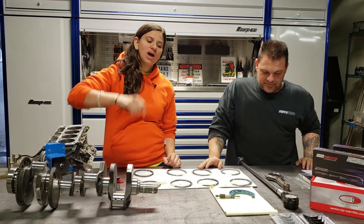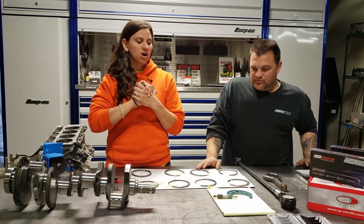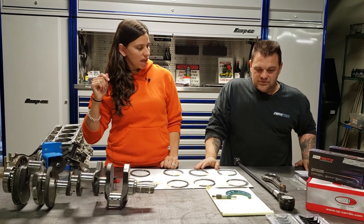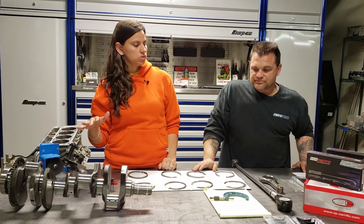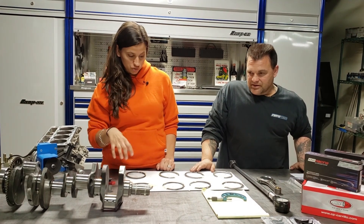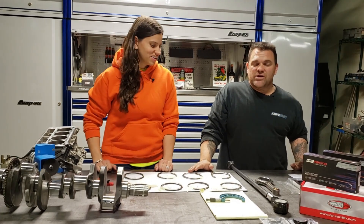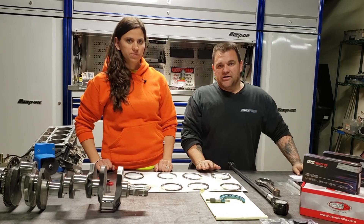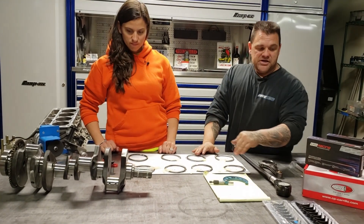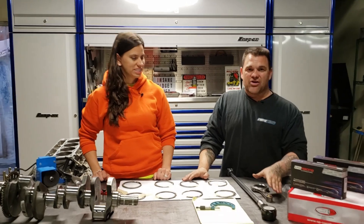Welcome to Project Grimaro. I'm Michelle Abadi and this is Brett from Insane Power. We're here in Henderson, Nevada, continuing the build of my Project Grimaro, which is a 2SS Chevy Camaro. We're working on getting the motor assembled and today Brett is going to show me how to fit the rings and how to fit my rod bearings. On the last episode we checked the main bearings and had the wrong clearances, so today we're checking rod bearing clearances. I've measured the crankshaft and I've got the rods out — I'm going to show you one for display, but I am going to check all eight rods.